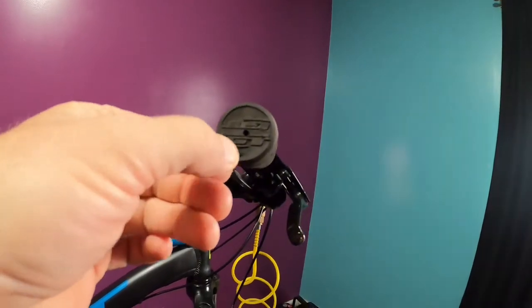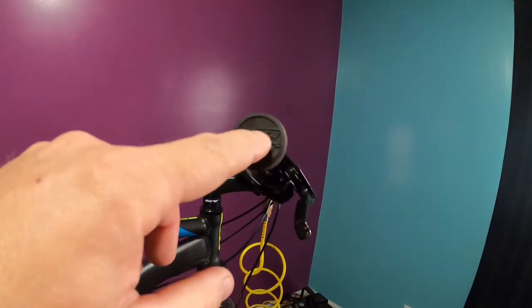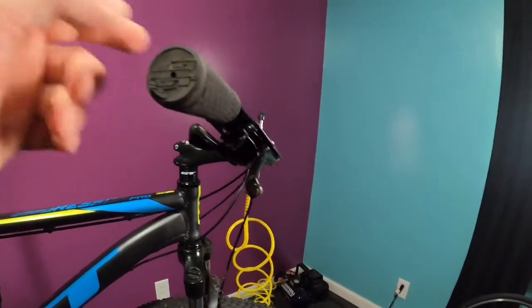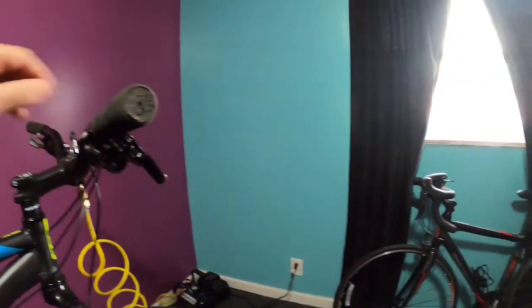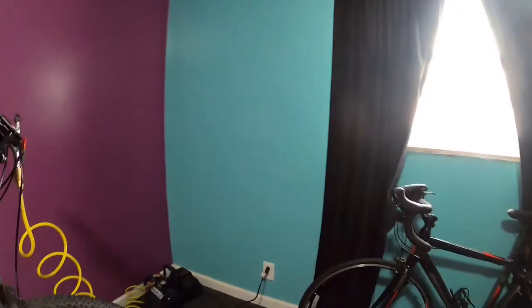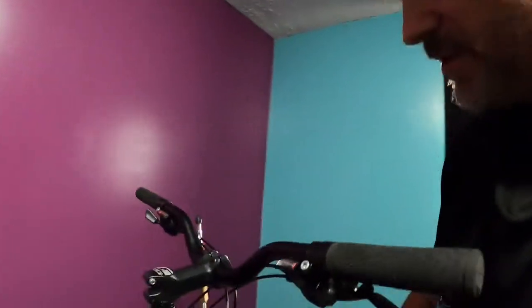Usually I'll shoot them off. A lot of times on this bike there's a hole in the center, but whoever had the bike before dropped it a couple times so it might not work as well. Normally what I'll do is put the blow gun in one end and my finger over the other, shoot one end off, then cap that end with my hand and it'll air up and push the other one out. Let's get started - first thing I'll do is loosen these shifters and brake levers off so I can get to it.